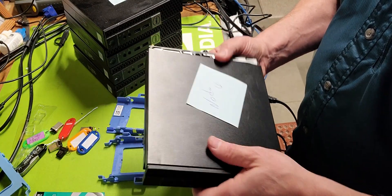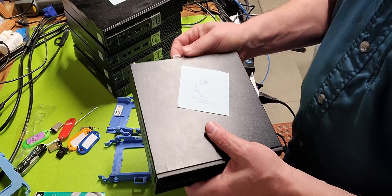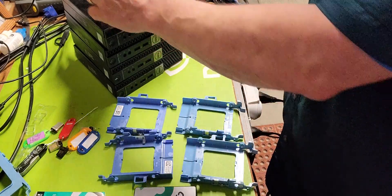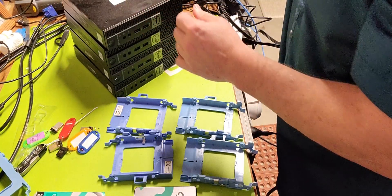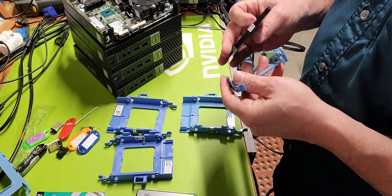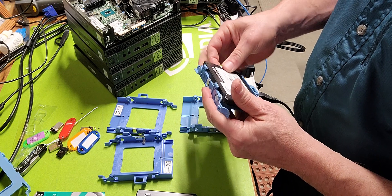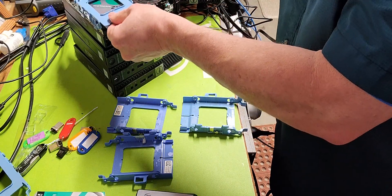This node now has 1.128TB capacity in two tiers. Two tiers means it has both an SSD boot drive — the M.2 — which has available resources you can use, and also the localized one-terabyte SATA connection, which is different from the M.2. Performance-wise, that's what really matters: SSD SATA is slightly slower than the M.2 standard, so because of that factor you have the ability to tier the storage.